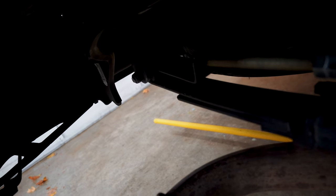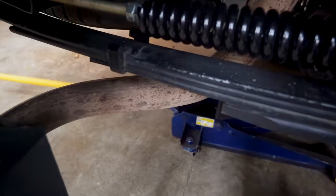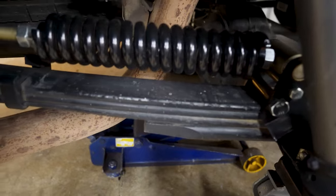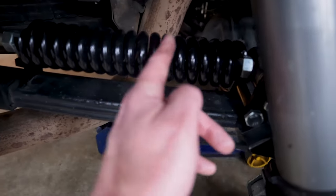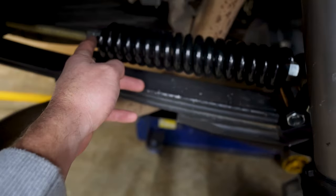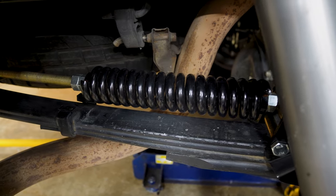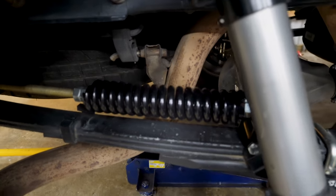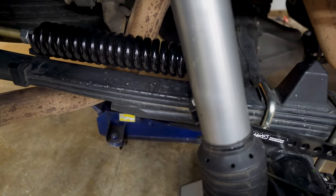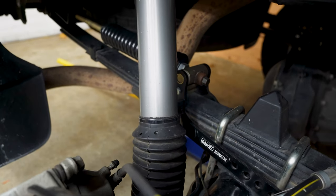Luckily in my case I have extended shackles, so I did not have to separate the shackle. If you have a stock truck, you will have to pull one side of that shackle off and slide it across. In my case it just slid right over the top for extra clearance. For my installation, I used a mixture of the white and black spacers. The white spacer goes between the coils, and once you tighten the nut to put tension on the coil, when that fits, that's a 20% capacity increase. You can tighten further until the black spacer fits, which is a 40% increase in weight capacity.